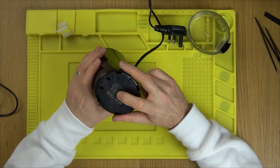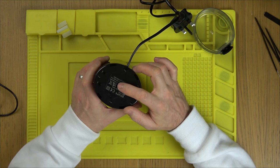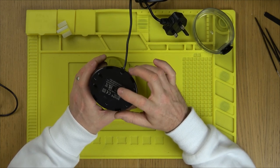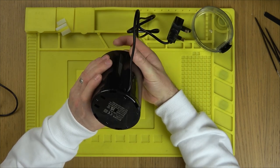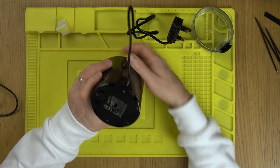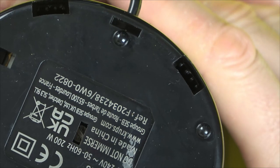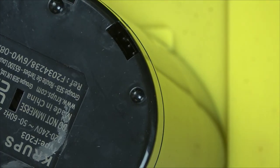Under the label there's a little slot here that you can put a screwdriver into. Let me zoom in — you can actually see the end of the motor. When I turn the blade, this part isn't turning. We might be able to just free it up. There's a little slot so let's get a tiny little screwdriver and see if we can turn that.